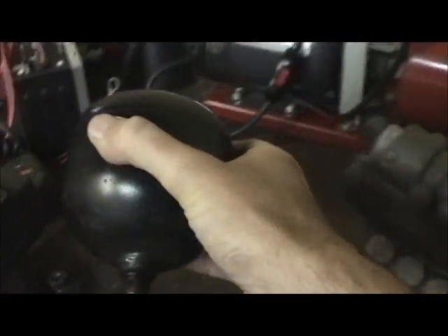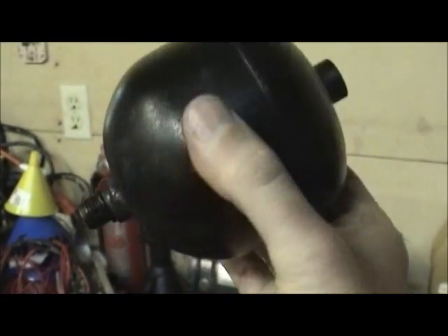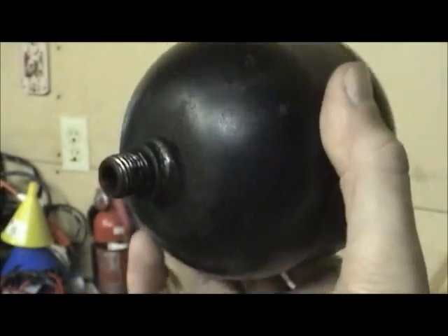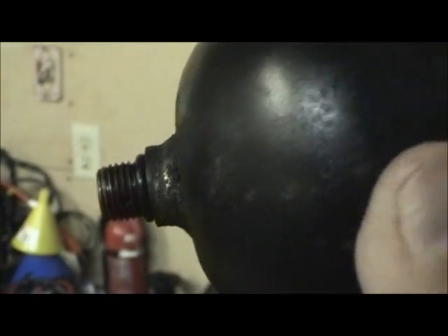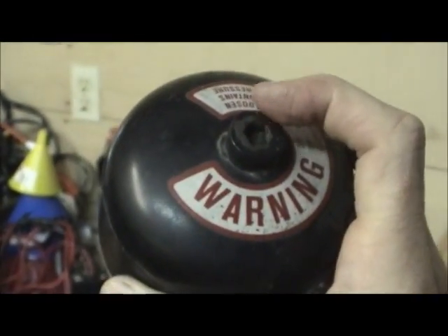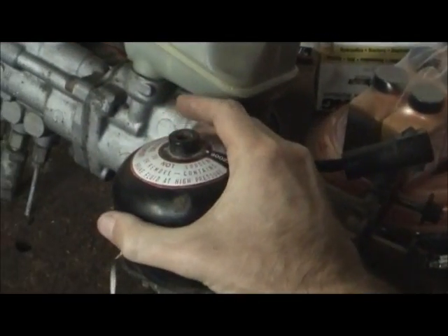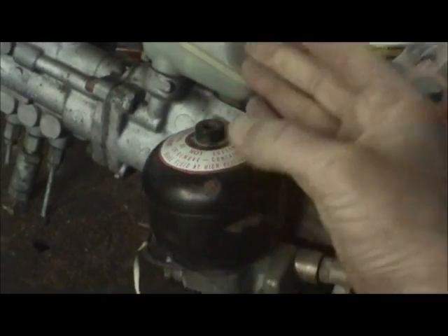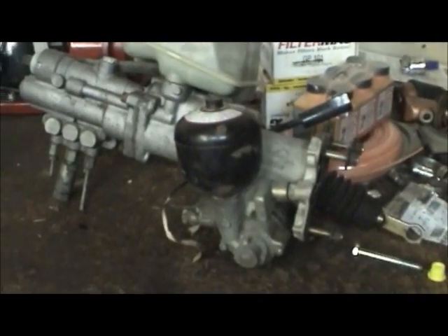I had this fail on my Lincoln, and this is what these accumulators look like. It's got a rather large opening down there, and then an O-ring on the end to form a seal. The new accumulator that I got didn't really have an Allen fitting on it, but if you've got the parts fairly clean and lubricate the O-ring with some brake fluid, you can get it on here pretty tight with just your hand. So not too hard of a job to do, not too hard to replace.